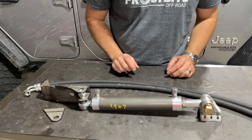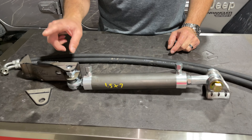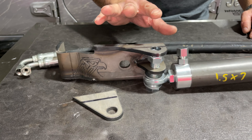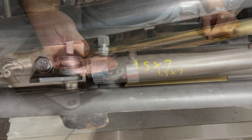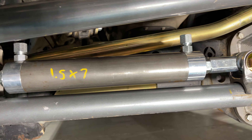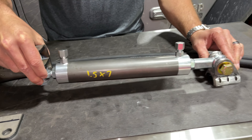We went ahead with a hydraulic ram assist - this one's from West Texas Off-Road, their Redneck Ram. We also went with a Next Venture Motorsports mount. We are going to have to modify this a little bit - when I test fit it up to the Jeep it was way too high. So what we're going to do is take one of the brackets that came with the ram, weld it on the bottom, and relocate it lower so everything stays nice and parallel.